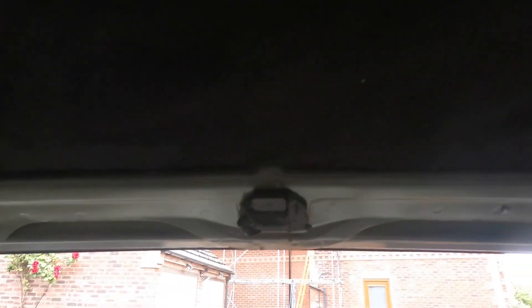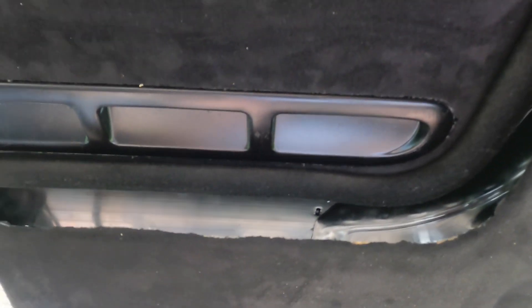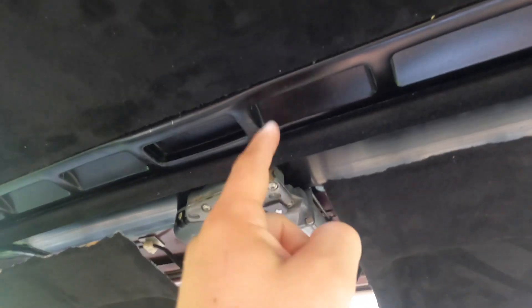That slides into the back and then the plastic trim goes over that. So we've got some plastic trim to go over it on the sides, and the other side. When all these are pushed up and clicked in it should go quite nicely, and then we'll put the front up there. So we could try and put the headliner into this - I might need to take that back out actually. I might do half - take it to there because we know it fits, push it around that half, then do the other half. I think we'll do that quickly now.